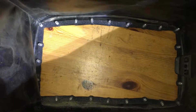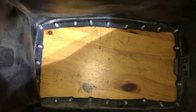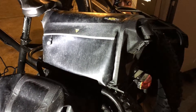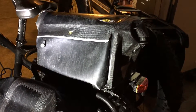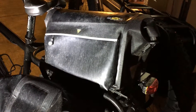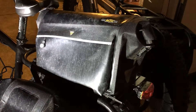This is the inside of my trunk bag — that's a very thin ABS frame, and I hogged out a lot to make as much room as possible for the controller to make sure it would fit. I used aluminum rivets, which like cable ties are economical, lightweight, and don't corrode. Once it's on there it just looks like a trunk bag. You can use a neoprene gasket for additional waterproofing — neoprene is the material used to make wetsuits, easily available online. Buy a rectangle and cut out a rectangular gasket. If you plan ahead, you can attach the trunk bag with six holes instead of four for additional waterproofing.